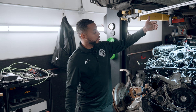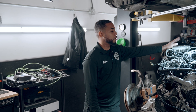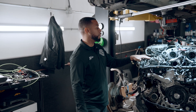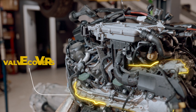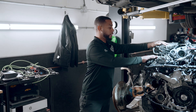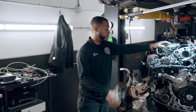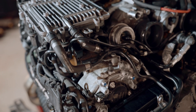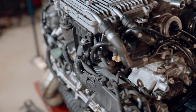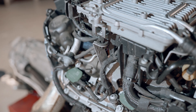The third common issue we've been seeing a lot is your valve covers. What people have been finding is when they go to do their spark plugs, they find oil in the hole, and these valve covers need to be resealed. That is a very, very big job. Is it possible to do in the car? It's possible, but it's very, very, very difficult. So a lot of people are dropping these engines to reseal them. You can see how much stuff is on the top of this valve cover — it's just a crazy amount of time and work.